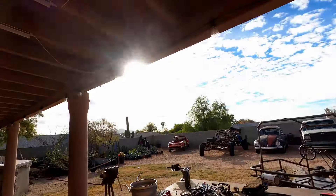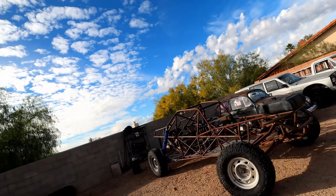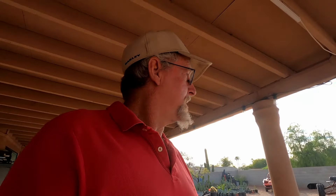Thanks a lot for watching — if you haven't subscribed, go ahead and do that. Let me know what you think about the golf cart, and if you have any ideas what's wrong with the 40 horse and Franken Buggy, I totally believe the intake manifold is clogged up. I literally dumped gas down it and it wasn't reaching the spark plugs — I pulled them out and they were dry. I probably have a quart of gasoline sitting in that intake manifold. I'm going to pull that motor out and might have to pull the heads. Next couple of days it's going to be all about the golf cart — let's get this thing running. Thanks guys, have a great evening, we'll see you later.